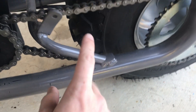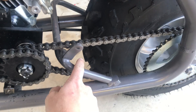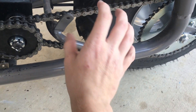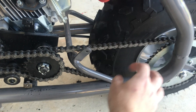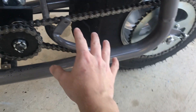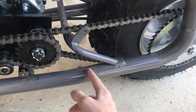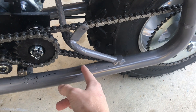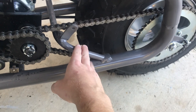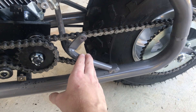One of the key things you have to do in order to install a torque converter on this bike is remove this brace here. All this does is hold your chain guard in place. I've already removed the chain guard to get this off, but it's not essential if you do want to put this back on afterward. What you could do is take this off and instead just weld on a bar from this side of the frame to that side. This doesn't appear to give any structural significance — it's strictly to hold the chain guard.